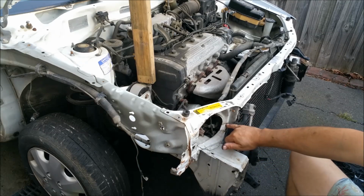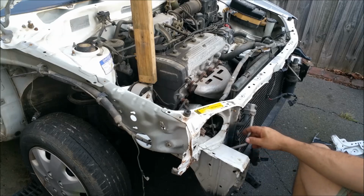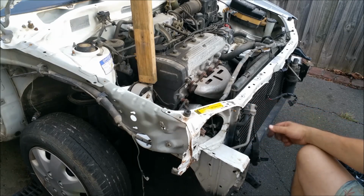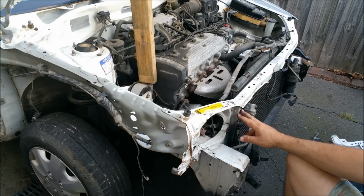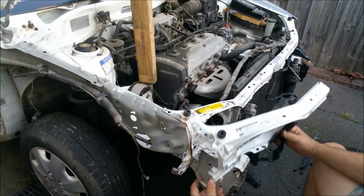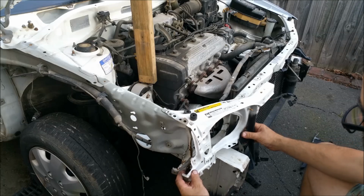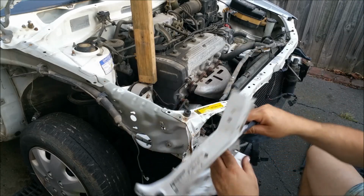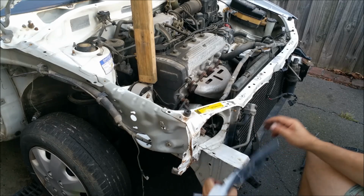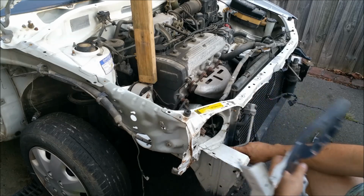We've got these, either they've been cut or they've cracked. The little plastic plug which held on the bracket for the bumper is stretched. I don't like it. I've actually gone to the wrecker and I've cut another one out of a car there. Drilled up spotties. I would be better off straightening that, disconnecting the aircon, but I'm not going to. I'm actually going to cut it above there and stitch it along there, or seam weld it along there.